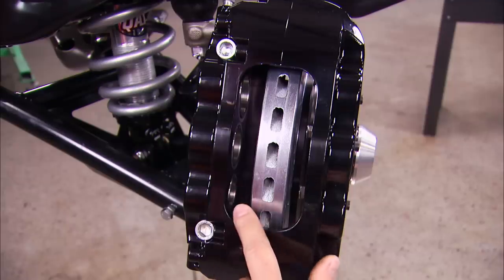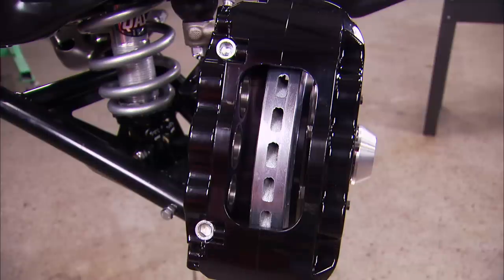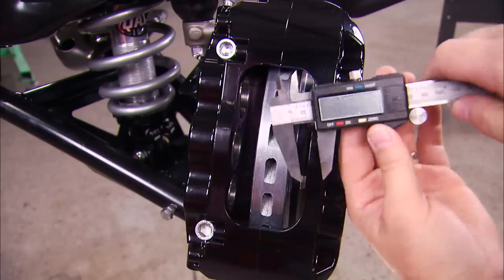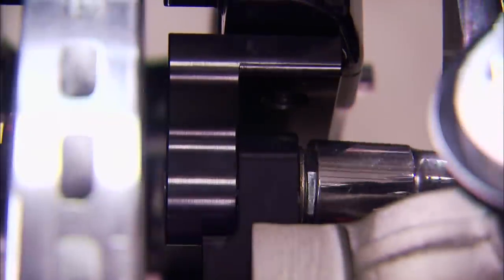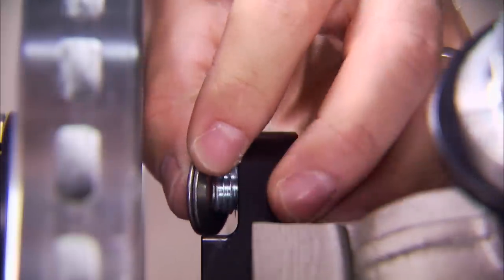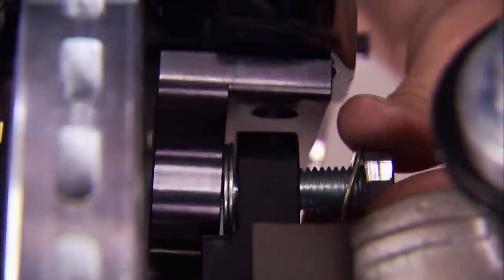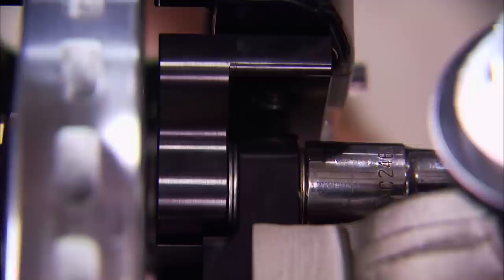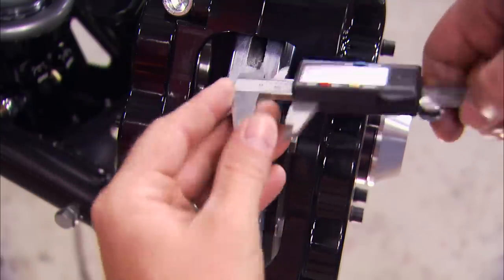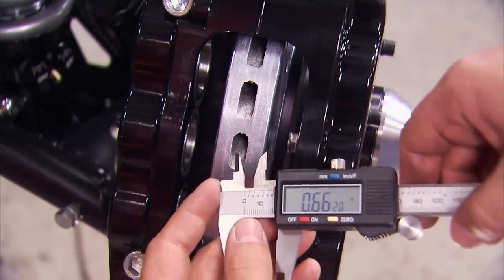As you can see, there's more gap on the inside of the rotor than on the outside, so we need to shim that caliper out. We'll take a couple of measurements on each side and get an average. The first measurement is 751 thousandths, followed by 765. On the other side, 563. With about 200 thousandths difference, we're going to remove the caliper, loosen the caliper adapter plate, and install 100 thousandths in spacers between the caliper bracket and the adapter plate. After tightening those down and reinstalling the caliper, we check our measurements — new readings range from 651 to 665 thousandths, so we're good.